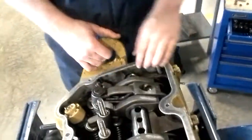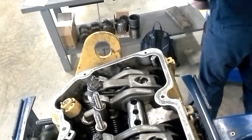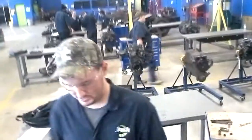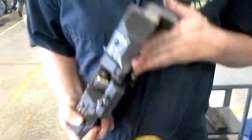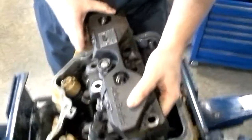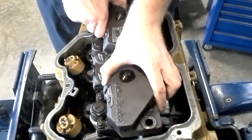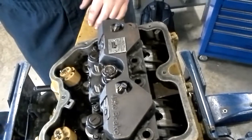At this point I'm going to go ahead and set my jake brake back in. Once you set this jake brake back in, all the bolts just go back together — it's very simple. CAT made it very simple when they engineered this engine. So with that guys, that's basically how to remove and reinstall an EUI injector from a CAT 3406E. See you guys later.